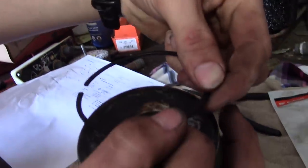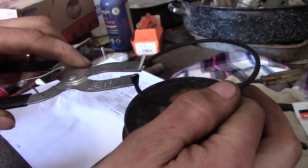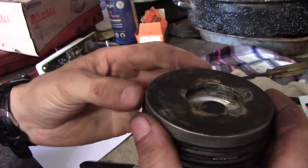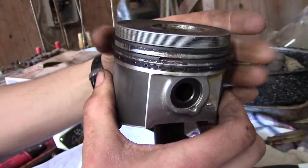Top ring — end goes up. Same thing again. Gently spread it. It's not supposed to pop off, but hey, it does. There. So that's ready to go back in the cylinder, just like that. Where the rings have to be, we'll use a ring compressor — that way it slides back in.